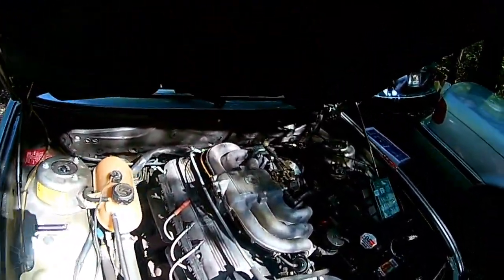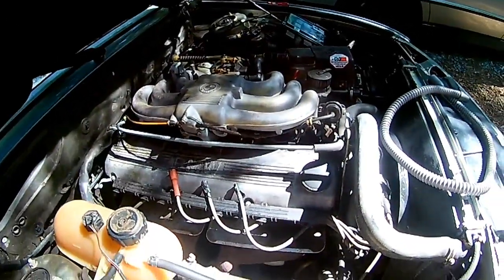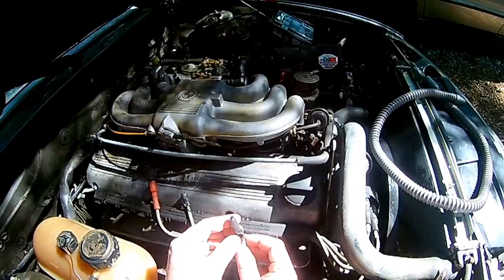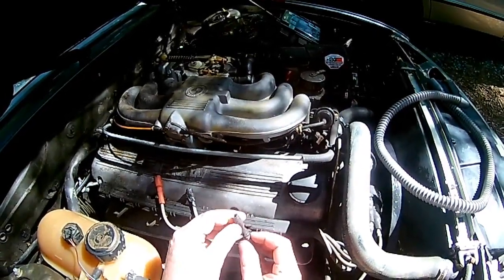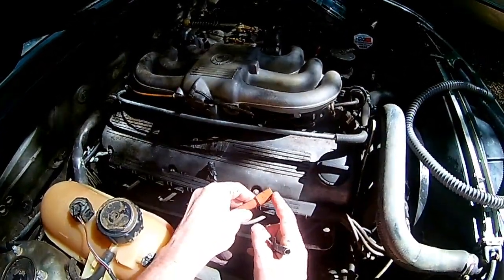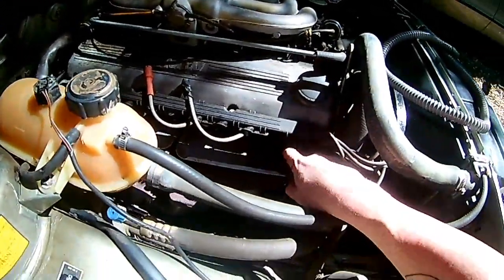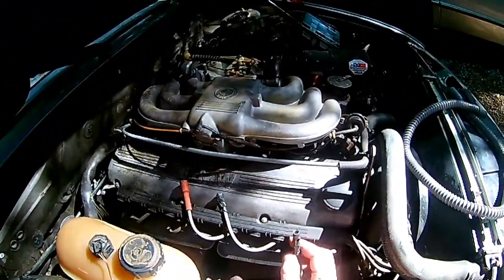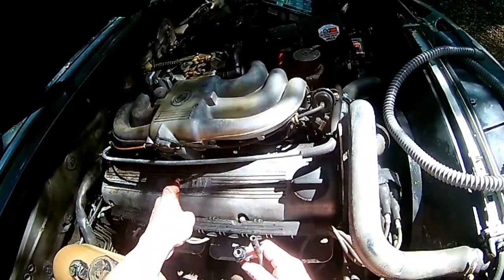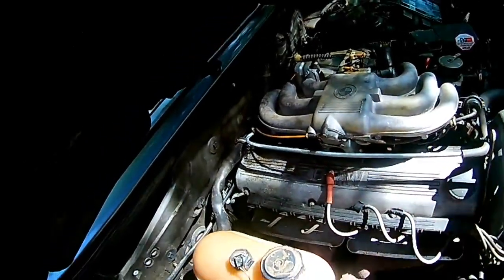I was coming out to look at the car and figured I'd go ahead and start the tune-up by changing the spark plugs. I popped the first spark plug wire off and look at that — the previous owner, rather than buy a new plug set, basically spliced these. This is what it's supposed to look like: orange rubber that suctions down to the spark plug boot, keeping crud out. But the first two plug wires are both just spliced and pushed on there, meaning there's no consistent connection — it's not actually suctioned down and doesn't have the boot to do that.